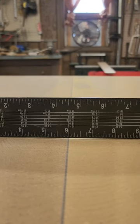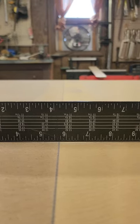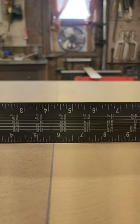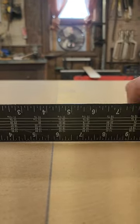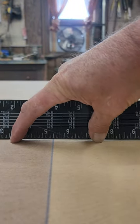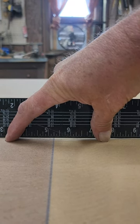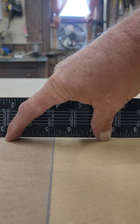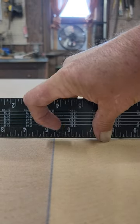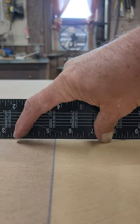I don't want to sand that seam just smooth and put bondo over it, because I don't want that seam to ghost through. I want to have a little bit of a groove, kind of a valley, that extends from about here to about where my thumb is. That's how far my bondo is going to bridge. That way I know I've got a good amount of bondo bridging over the top of that seam, and that will prevent that seam from ghosting through.